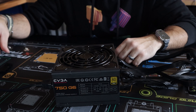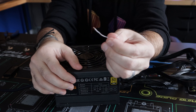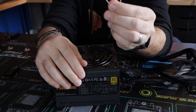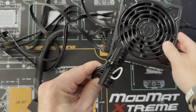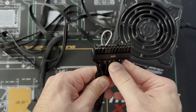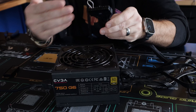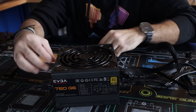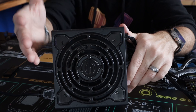If you don't have one of those jumpers, you're going to have to use a jumper wire. I took a wire from an ethernet cable, cut off the ends to expose the copper wiring. Looking at the connector face-on with the clip on top, you're going to go to the third and fourth pins on the power supply connector on the left side. Once your wire is in place, make sure the power supply is connected, then turn on the power switch — if everything is good you should see the fan spinning.